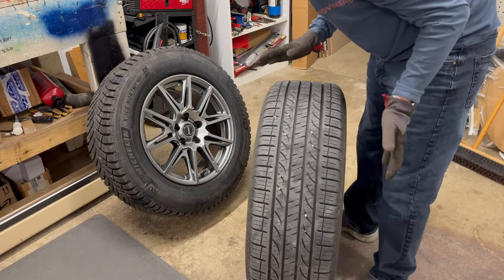The wheels and tires are on. Go around and make sure they're seated properly — look where the wheel meets the brake rotor or hub and make sure that's right. Then torque the lug nuts to 76 pound-feet in the star pattern, going all the way around. The last thing is to make sure they're inflated to the right pressure — in this case, 35 psi front and rear.